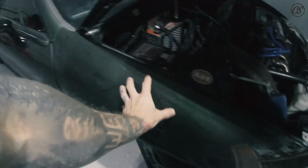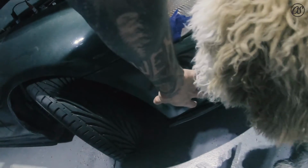Okay, that's fine. Whatever. I did get the front kits installed. My issue I was running into is all of the stuff up front just wasn't aligning because my Del Sol was a salvage Del Sol way back in the day, almost 10 years ago now. And I think there was just a lot of stuff shifted. So I had to pretty much take this off, take the headlights out, take the bumper off again. I had to take off the bracket for the headlights, and I had to realign everything because the holes for the lifter kit weren't aligning with the holes where the bolts were supposed to go. And I just couldn't get them in. I was trying for 2 hours yesterday, and I just said, okay, I guess I have to realign all this stuff. So I did. I got all that realigned.